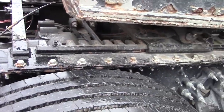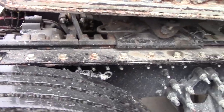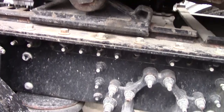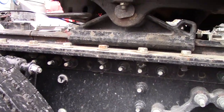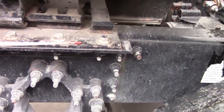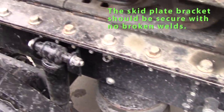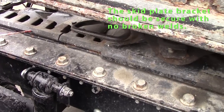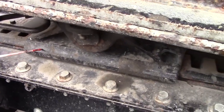We'll move on to the fifth wheel area. Starting from the bottom, I'll check my bolts to make sure there are no missing bolts — they should all be tight. Check the bracket to make sure there are no broken welds; it should be straight and not rusted.